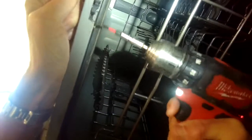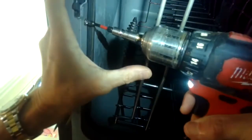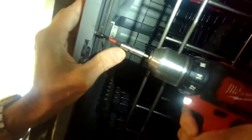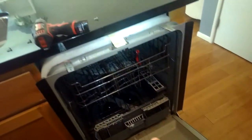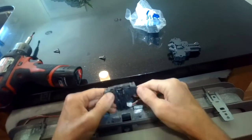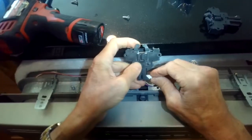I'm going to remove these two Phillips head screws and then take off the old lock. It's probably 80% of the time when you get this three-beep thing that it would be fixed by replacing this part, which is only about $20. If it doesn't work, it could be the main controller that's actually malfunctioning. It's also possible that the wires leading down to the controller are damaged, but that's pretty unlikely.